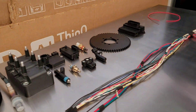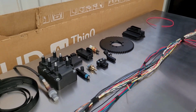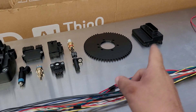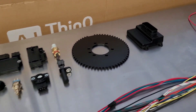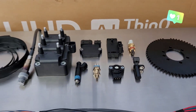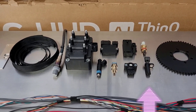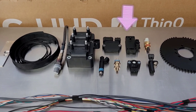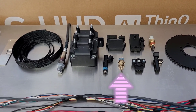All right, as you can see we have everything unboxed and I'll go ahead and show you exactly what we use. This is going to be kind of like one of my DIY videos. I'm going to explain to you guys how I do EFI, what sensors I use, and what ECU we're using. To start with, we have a Micro Squirt ECU, a 60-minus-2 trigger wheel, a VR-style universal crankshaft position sensor, a GM IAT sensor as well as a GM MAP sensor, and we're using a BMW M50 throttle position sensor. We do use the original stock coolant temp sensor.